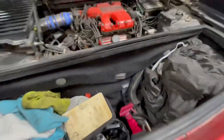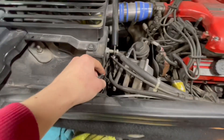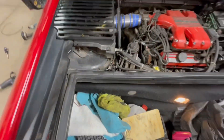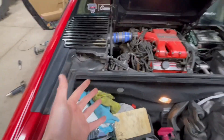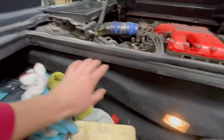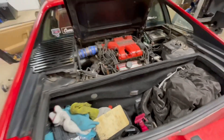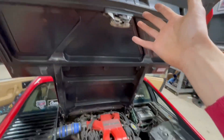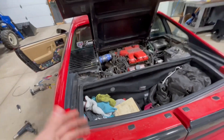Just like the one back here — right now my trunk light is out, and now I flip the switch and I got a trunk light. I literally just took the wire, cut it in half, and put a switch in. This is a temporary spot — I want to find a place to mount it, but I kind of just put that on there and never really got around to finding a spot. I'm still looking for one. I think maybe in the corner on the trunk somewhere around here would be cool, so I can go in, flip the switch, have it shut off. It's definitely helpful when you're working on the engine and you have to have the deck lit up and you don't want to kill your battery.